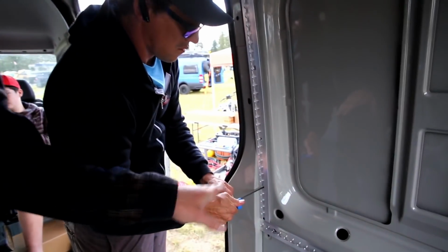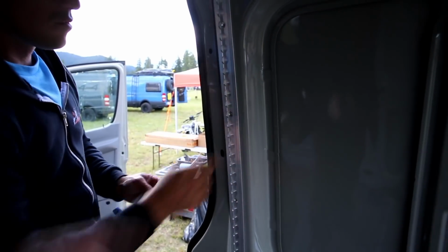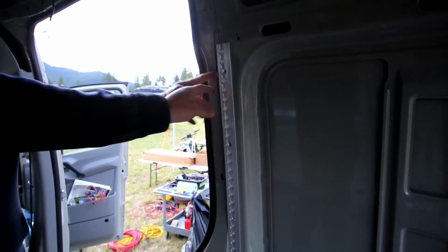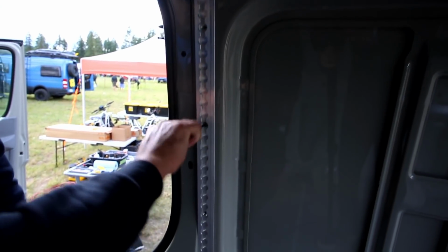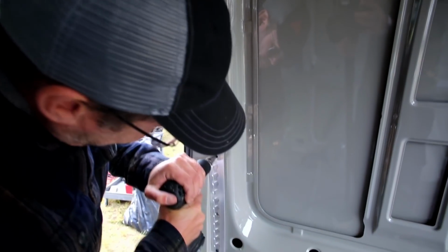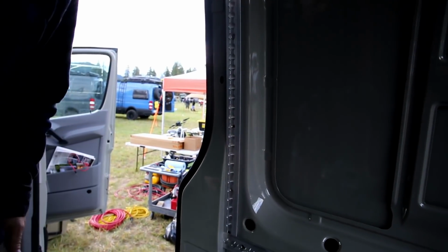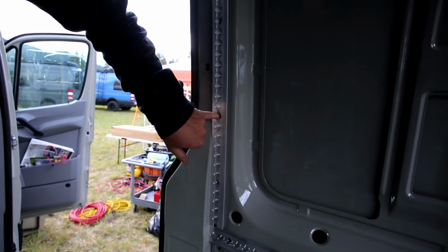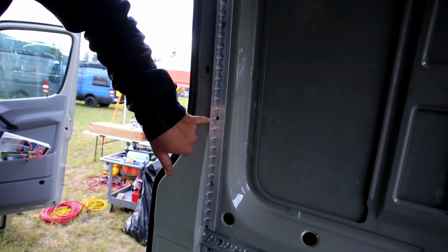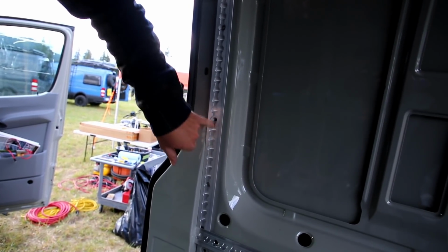So we're making sure that we're tightening them all the way up, because you don't want it slipping around. We're going to be drilling out the holes. As you can see, had we drilled this one out, if you can look straight on here, had we drilled that out, we would have been way off center, and then our bolt won't line up. So when we do this one, I'll be pulling this way with it to center it out. If it barely touches or kisses the inside of this, that's fine. Just make sure you don't bore out a whole lot of material from the aluminum.